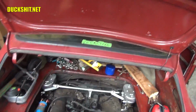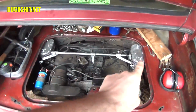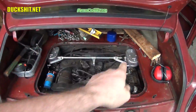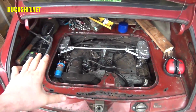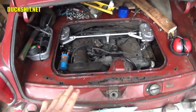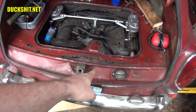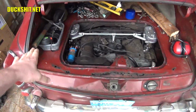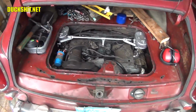Now, the problem that I had, and you notice that I have eliminated, is that I got the air filters inside of here. What I had to do is raise the flange up in the trunk area here because it had been crushed, and it had been terribly crushed, probably by somebody way overloading this trunk. Now, I'm not done here yet. You probably noticed that a little bit is still kind of wavy. There's some places I had a little trouble with it coming up, and I'm still going to have to cut this piece out of here to finish that up. But the entire flange is nearly level. I have to put a straight edge on it and make sure that I get it about straight.